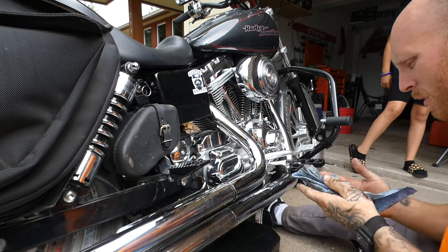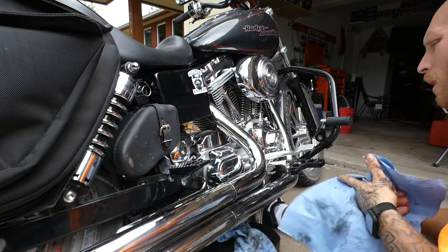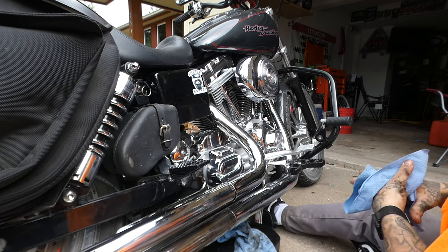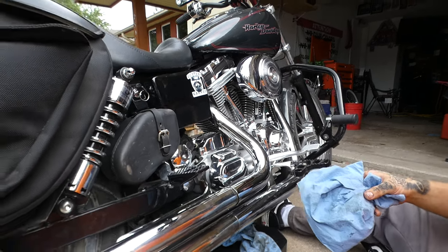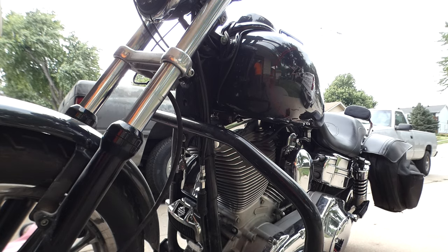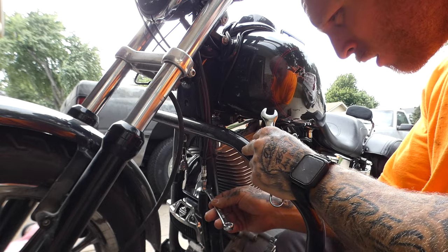Now, with all the oil out, before we pull this off, we're gonna loosen the clutch adjustment. Do you remember how to do that? Okay. We're just gonna loosen the clutch cable. It's right there. Just gotta loosen that up. I think we need a half inch and a 9/16. All right, Abs. Where you at? Right here.